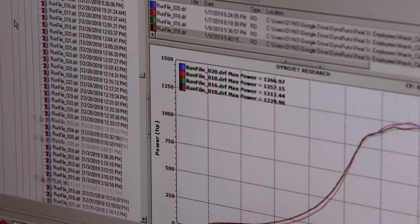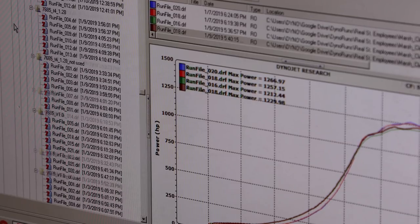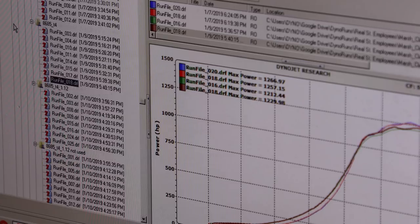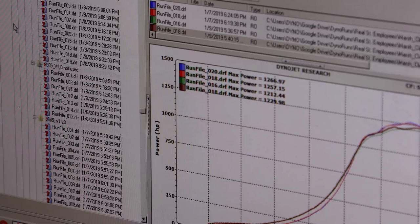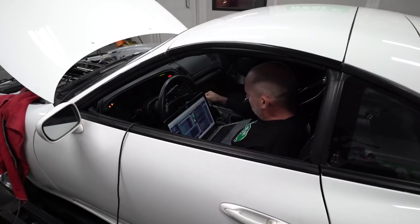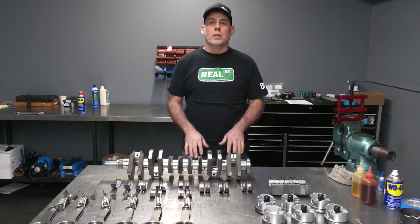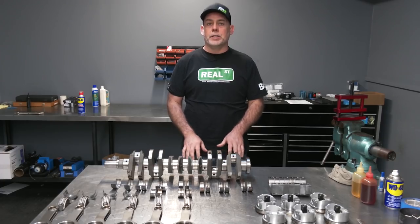It was run around 1000 runs, around 1000 horsepower. And when we got through with our turbo testing, we basically wanted to see how will it die? So I had put some fuel through it during fuel testing that was questionable, and we were able to produce some detonation. Detonation is both a slow killer and an aggressive killer. So there's signs of knock and signs of knock damage throughout these parts. Let's take a look and see how detonation kills these components.